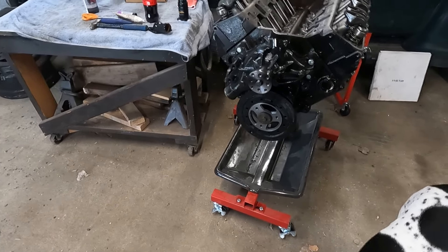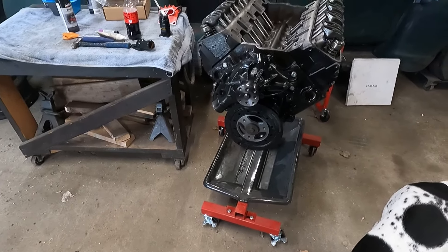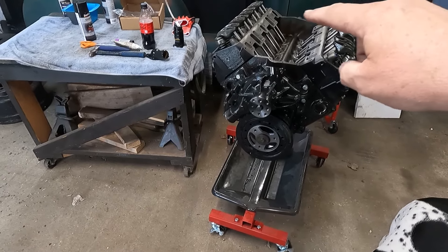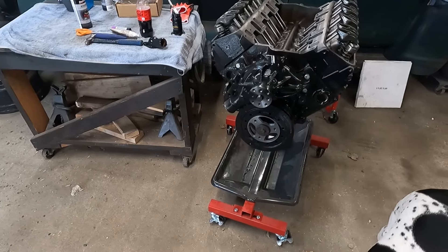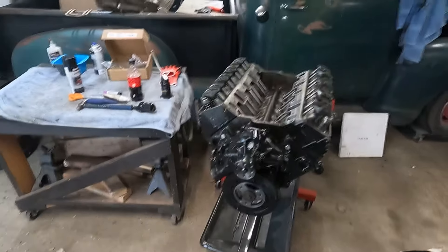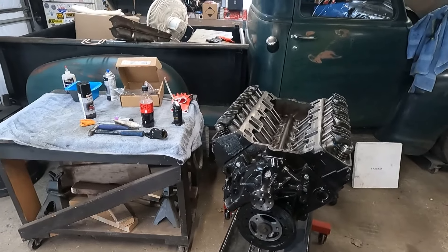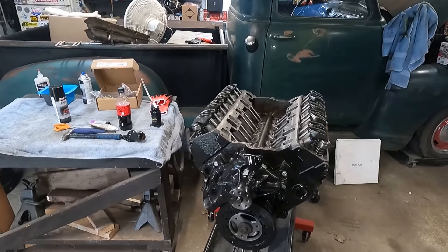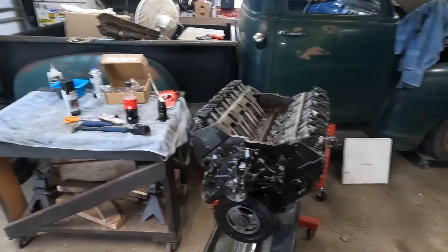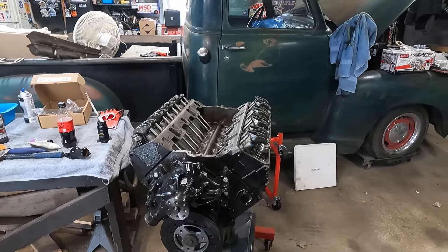What I have left to do: put the intake on — RTV silicone on both China walls, bolted down, done. And I'm taking it off to break it in. This video is going to suck but it's done and this motor is done and I can get it off to my buddy's to bring it in. So thanks for watching, don't give up on us — we're still hanging in there. Never forget: drive your shit. We'll see ya.